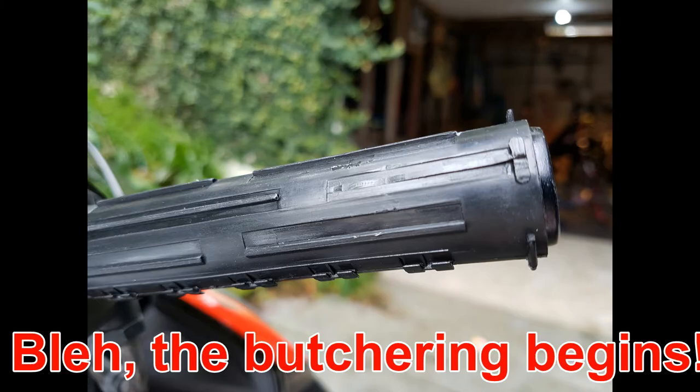So chop it off, and then once you've done that, the next part is to take the back seat off. So you take the back seat off and disconnect the battery. Now, this is quite funny. Well, it's not really, but I'm going to tell you anyway. So, take the minus off first, then take the positive off.